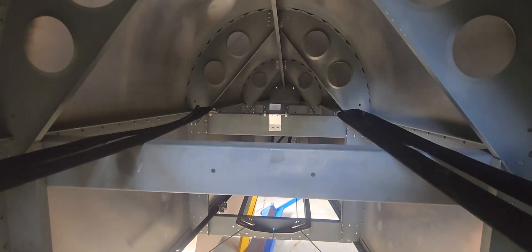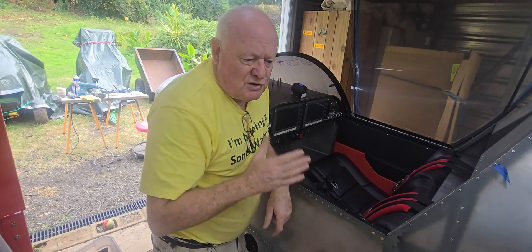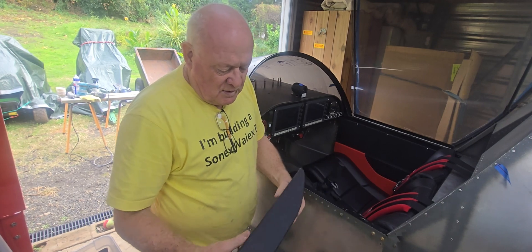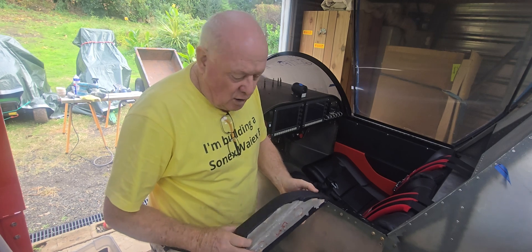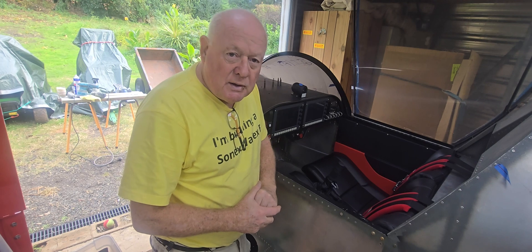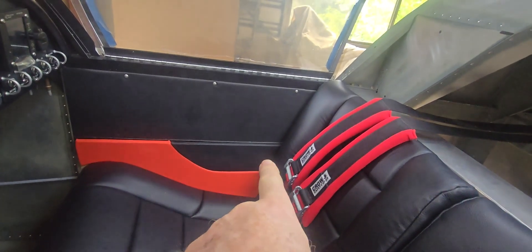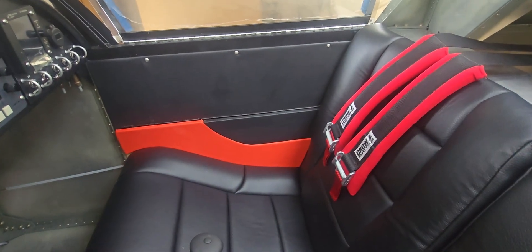I've made some modifications to the cockpit. Closing off this video — I've made modifications to the inside lining of the fuselage sides. Before, I had a fiberglass shape I made but I think I was over-complicating it. Although I was trying to convince myself it wasn't intrusive, in the end I realized I was way over-complicating it. I've kept the same design with the red and black — I think it's much better. I've still kept the D-shape that allows the rudder cable to run all the way through behind and out the back to the mixer control. The seats are easily pulled up and all cabling from the rear of the turtle deck can still come through as planned.